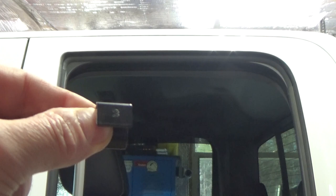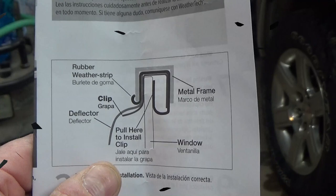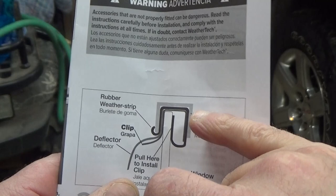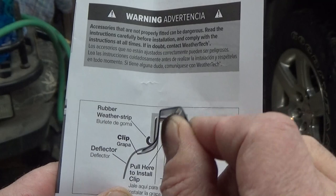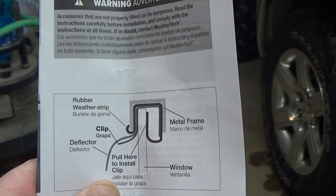For the rear, we're going to install these little metal clips. There's even a little '3' on the clip because we're going to position it three inches off each side. On one of the tools they're actually measured out to three inches, so we can use the tool to measure how far we need to install the clip from each side. I'm going to mark it with a marker to give me a rough idea. Here's the clip itself — the curved piece goes to the outside of the door. The problem is this weatherstripping isn't exactly what the instructions show. Let's zoom in and look at how I installed the clip on the other side, and I think it's going to work just fine.